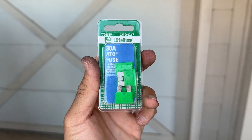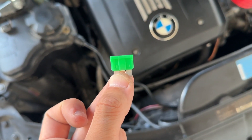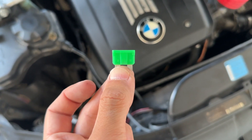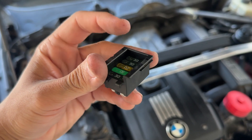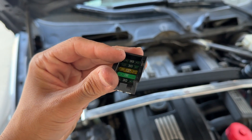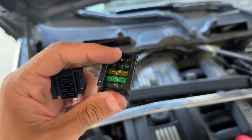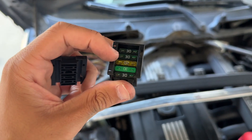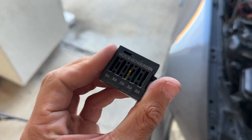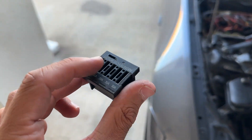We're going to replace it — I have some 30 amp fuses here with a link below for the best price. I got fuses that were a different color so I'd know in the future exactly which fuse it is more quickly. Simply drop it into place just like that. From here throw the lid back on and reinstall this back to the fuse box. While you already have it removed, go ahead and check all the other fuses to make sure nothing else is blown. Slide the little lid back on and make sure it snaps into place with an audible little pop.